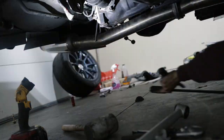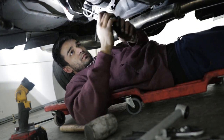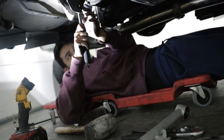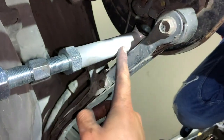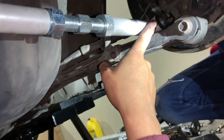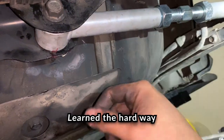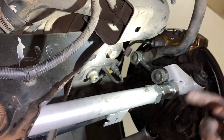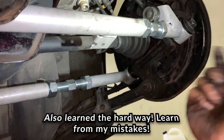I had to bust out a file because there was a slight burr that wasn't allowing me to install the lateral links, so I just deburred it real quick and it went in smoothly. For the front one — the one closer to the front of the car — the inner diameter of the bushing is a little different from one end to the other. You want the bigger bushing to go over the larger bolt we saw earlier, because if you do it the opposite way the bushing is too small and it won't work.